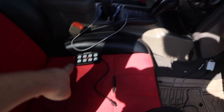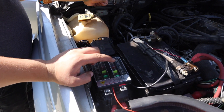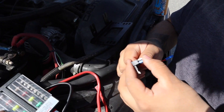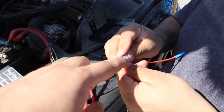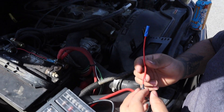The communication wire runs through the fender and comes out over here. We're going to zip tie it onto that bracket, and underneath there is the rubber boot for the door panel — we'll cut a small slit and run it through, leaving just enough slack to reach the ashtray where I want to put the buttons. The kit includes heat shrink to cover the cable connections so nothing shorts out. The fuse box requires accessory switch power, and included in the package is an add-a-fuse. We took the fuse out for the injectors and stuck the add-a-fuse in — 15 amp — so you get power for the switch through that.